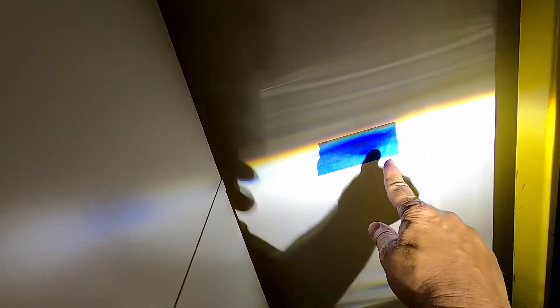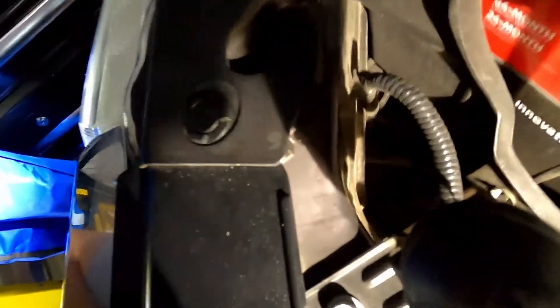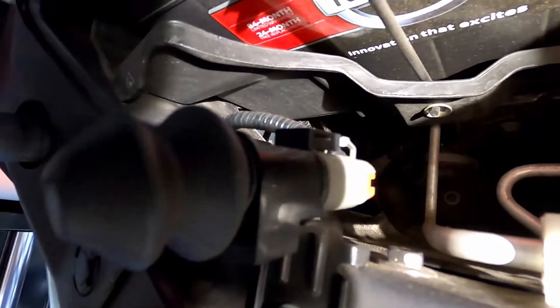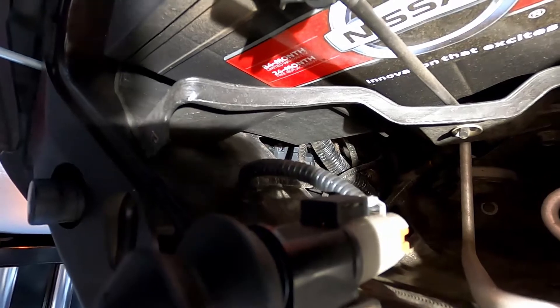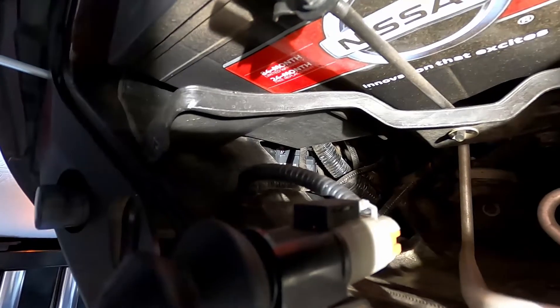You can see the positioning of the right headlamp as it is right now — I'm going to go ahead and raise it up two inches. I'm just touching the teeth, so I'll go ahead and rotate it clockwise. You want to put a little bit of pressure on the teeth so they'll move.